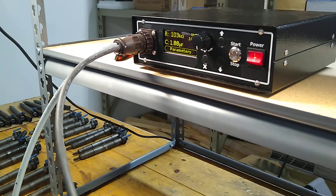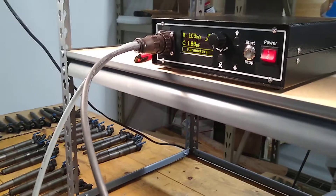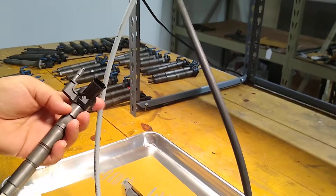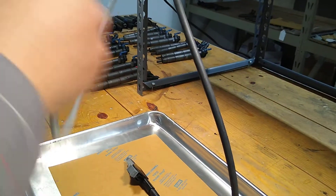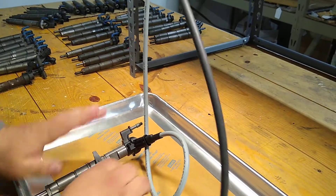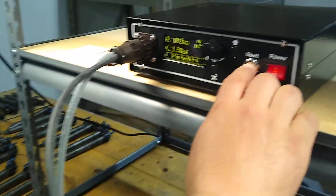We've got an electrical tester. We're going to check two different things on these to verify that they're good. First is to check the resistance and capacitance of the piezo stack itself. To do that, we plug a test cable into the injector body connector, clamp off onto the injector body with the ground, and we push the start button on the magic box.